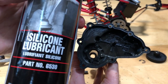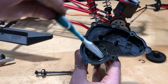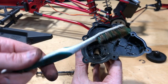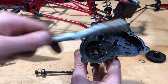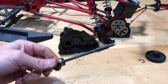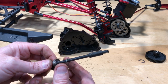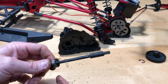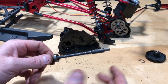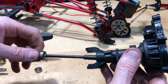I used a little bit of silicone lubricant — just sprayed in here and then went in with a brush to clean everything up and lubricate it. It's got marine grease on there now to coat everything, all the screws. As far as the axle that's here, I'm going to go ahead and clean this up, remove the bearing, keep an eye on the little spacers — washers or shims — and then I'll put our axle back in and slide that in there.